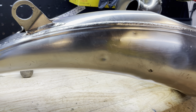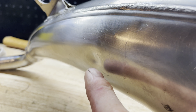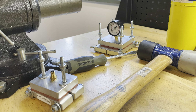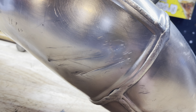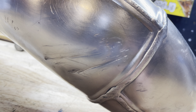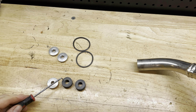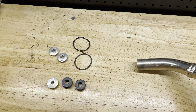The HydroForce is great for big dents. But if you want to get real cute with little guys, that's where the heat comes in. I've also done larger dents with heat — it works pretty well. I did this one previously with heat because it was right on a seam, and the HydroForce wouldn't do an amazing job right there. Since you're going to be using heat, it's important that you remove the rubber mounts and the O-rings by the flange — you don't want to melt those.